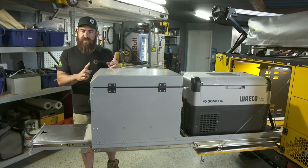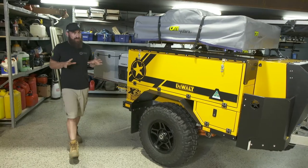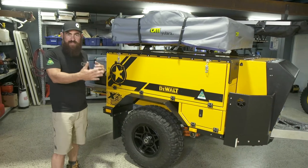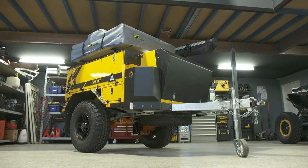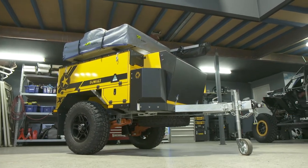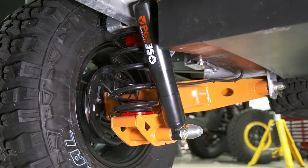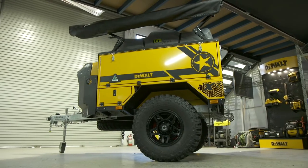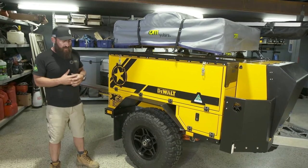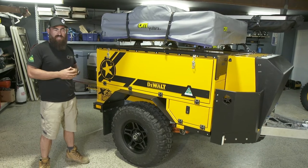We'll move around to the DeWalt side — I call it the DeWalt side because this is where we made the modifications specifically for DeWalt. Coming up to the driver's side of the trailer, this trailer is only three metres long, so realistically there is nowhere that you cannot take it. You've got 33 inch tyres, PCOR 16 by 8 inch wheels, and a 10 inch electric drum brake. The chassis is all hot-dip galvanised and all of the boxes are aluminium, so everything above the chassis is non-corrosive. There are grease points and service points on the hitch and all of the suspension.